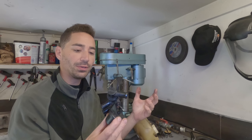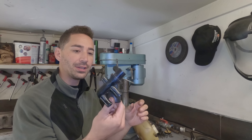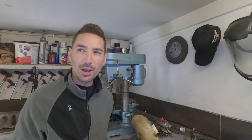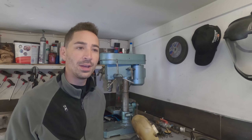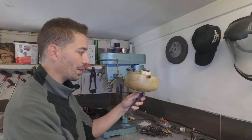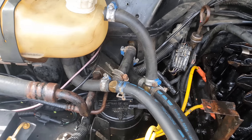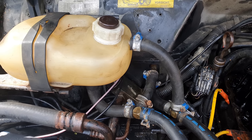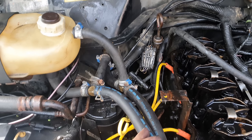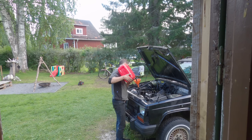But I've just got a couple more jobs to do. One is to clean up this valve cover — I had to put this in the fire to burn off the sludge because it was so coked up with garbage. These crank vents here are blocked — well, one of them isn't, the other one is — so I've got to take those apart and clean that. Maybe I'll give it a lick of paint. The other thing is this valve that stops coolant going into the heater core in the summer — some sort of climate control. It looks awful and it's broken anyway, so I'm eliminating that. I've got these little brass three-ways, so I'm going to rig something up.